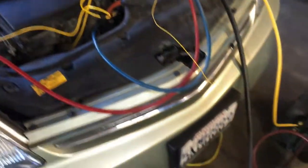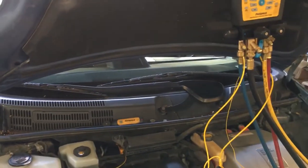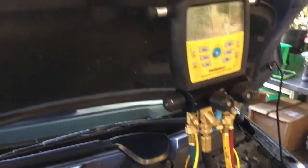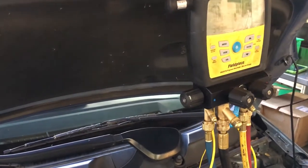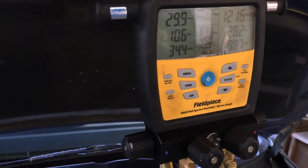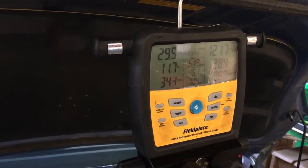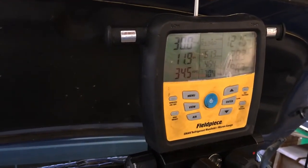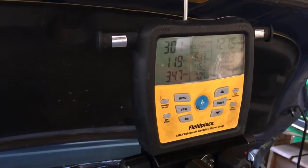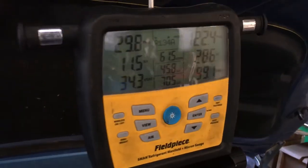All I'm going to do is remove and weigh the quantity of refrigerant, and see if I can measure his leak-down rate over one year — did he lose one ounce or did he lose nothing? I want to know the precise amount of refrigerant I put in a year ago versus what comes out now. I have another customer coming, but they haven't shown up yet, so I have a little time. I'm doing the technician's car for my own satisfaction — to know his vehicle is still in good operation. I'll do a before-and-after comparison, and if there's one ounce less we'll know this vehicle loses one ounce of refrigerant per year. Let's find out.